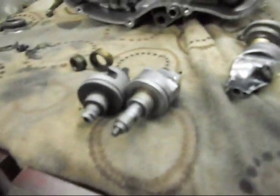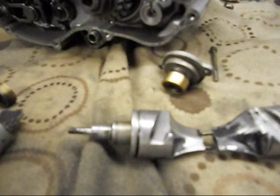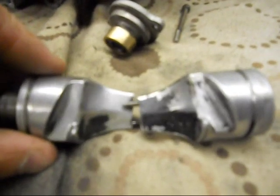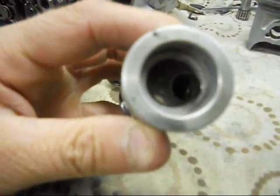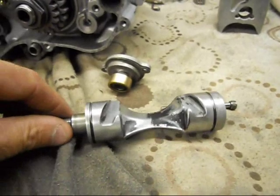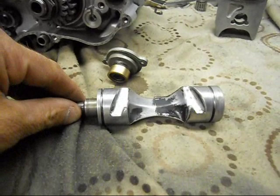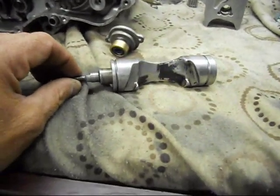It can be fabricated. Right now it's in two halves — this is the new one from the States, and the mate sent it with a broken bit that holds it on, so it's actually pointless. Anyway, they go together — there are two pins like that going together. On this end there's a hole which that goes into, and I'll put a bit of Loctite in there just to hold it and stop it all coming apart. Inside the barrel it just literally turns like that, from partially blocking to having full bore — at tick-over and then when the governor comes in it opens and allows more gases out.